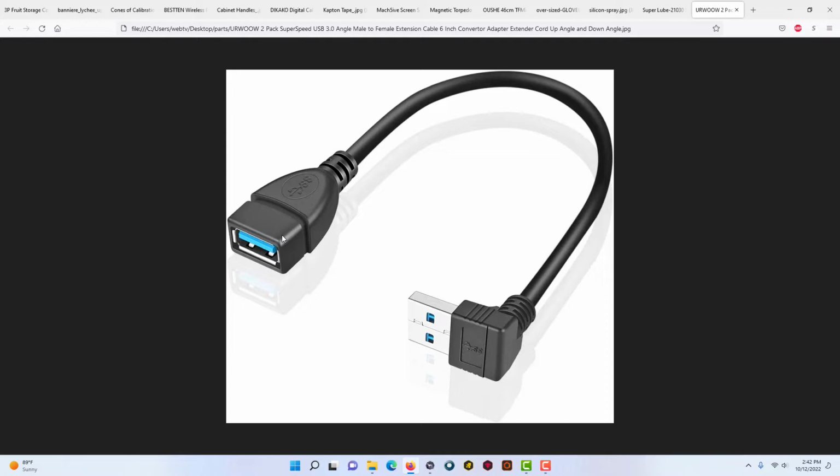And it's the same way. Okay, now I'm using a Mini 8K as an example of this. And I also have some for my Anycubic Photon M3. Basically, it almost looks like the strap, but you've got to look at the angles on here. They have some that don't have an angle and go straight out. Well, with that you're putting a little tension on that port. So you want to make sure it goes 90 down. Okay, remember that. Now they got some that you'll think are 90 down. Next thing you know, you made a mistake and bought the wrong one, because it'll be a 90 up. And you definitely don't want this cord to go up in the air and swing around to the front, because you will put some pressure on it. Push 90 down, that way the cord is facing to the bottom.